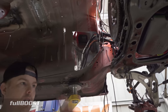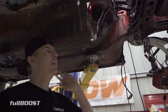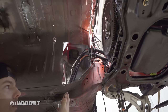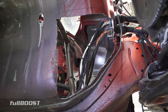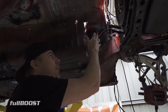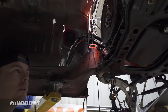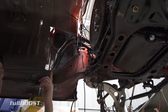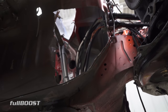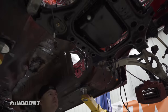Fitting the transmission - we had to custom make the bell housing, which meant even with an off-the-shelf one we would have had to do some tunnel work, which is what we've done. Unfortunately we have a giant hole in the tunnel, but what I'll do is make a thin steel concave pocket here and bolt it in. That'll be easier than welding to this one-millimetre thin steel. That way I can easily take it out if I need to access the starter, because once the starter motor's in there it's going to be really difficult to get to.